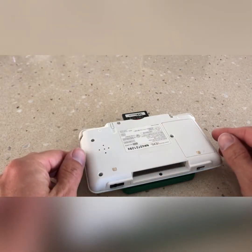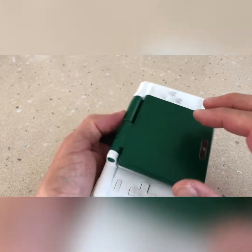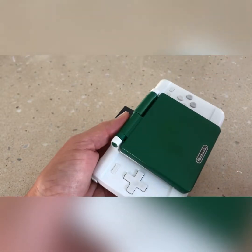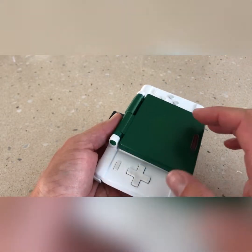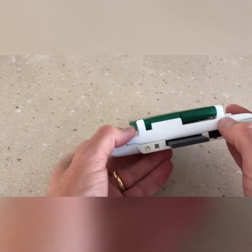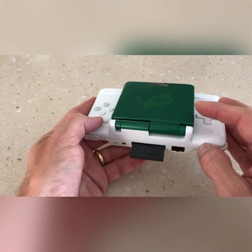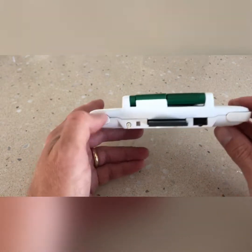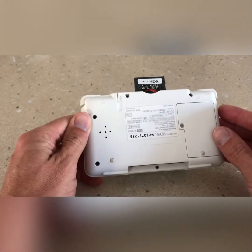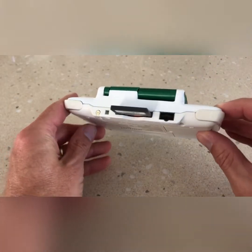So as you saw through the video for the build, it's not just a simple clip in the hinge for the SP shell and away you go. You actually have to mold on the rear hinge to make it fit, and there has to be a little bit of an adjustment as well. So we decided to mount the speaker in the back, so a lot of people ask about that, and obviously it takes Game Boy Advance and still the DS games.